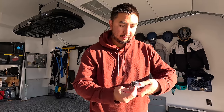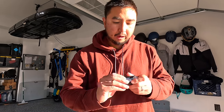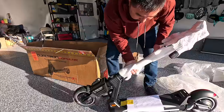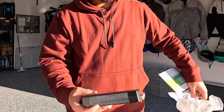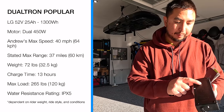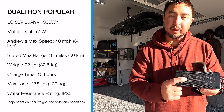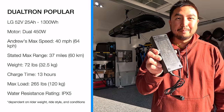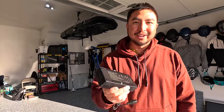The Dualtron tool is made of nice quality metal but they're a little bit too short — I wish these were just a couple inches longer. This is a 25 amp hour battery. The charger is a 58.1 volt 2 amp output, so this should take you 12 and a half hours to charge from empty to full. This charger actually has bigger output than the Dualtron Thunder 3 charger.